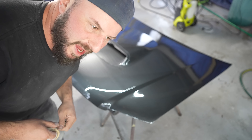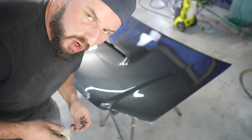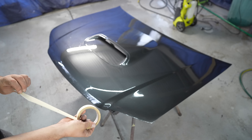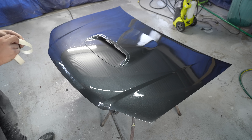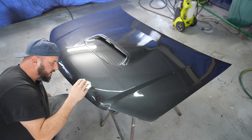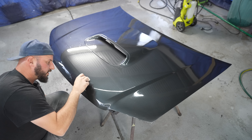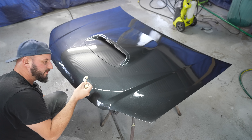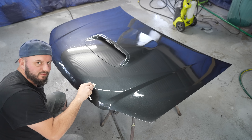The chances are if you do try something yourself, unless you're absolutely on point and get everything fully correct, you're going to mess up. I've seen guys use masking tape to grab at it — might try that. This could be a complete disaster but I'm going to give it another coat. So I've got a little piece of tape coming out now. Where the imperfection is, you just kind of peel it — it's like peeling it off. Let's just do that over the whole bonnet. It's literally pulling it right off. And then when I go over it again I'll show you what the final result looks like.